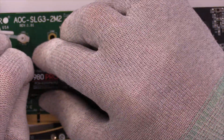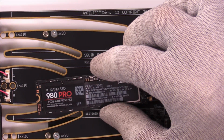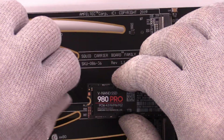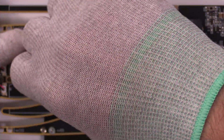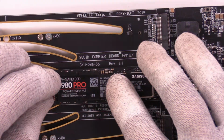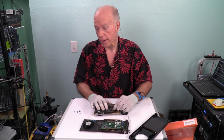So we'll take the second drive, and the WD Black SN850 is a little faster than the Samsung 980 Pro, and both the WD Black SN850 and the Samsung 980 Pro have had firmware applied to them. We had to restore performance on one of the quad cards, but it was not required on the Samsung, but because we were testing both drives, we went ahead and applied the firmware. Samsung had, I think, a little bit better instructions on the process of what to expect updating the firmware, where they talked about rebooting, whereas the WD Black didn't bother to mention, oh, by the way, you might want to power down and reboot, or else performance is going to be like SOL. But from past experience of things like that, we did that, and yeah, it worked.